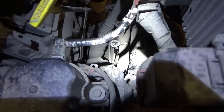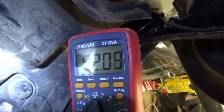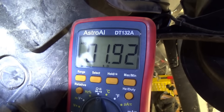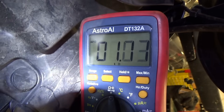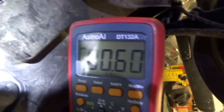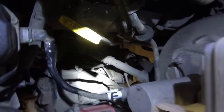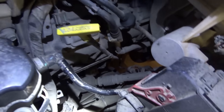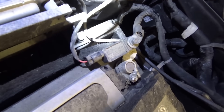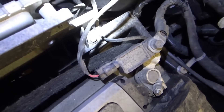We have a feeling the problem is going to be somewhere down here where it goes into that fat harness. Doing a little more tugging — the resistance is changing like that, so it should be almost broken. I'm noticing on the ohmmeter: if I lift this part of the harness up, the resistance reliably goes to zero — I can basically fix the circuit. If I let it relax and bounce it around, resistance goes back up. So there's a broken wire inside that harness. We've got to open it up, and it's got to be the leg going to this connector right here.